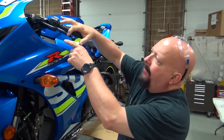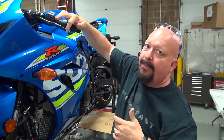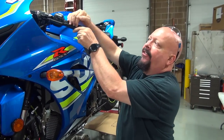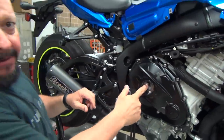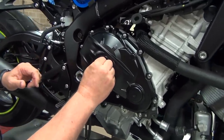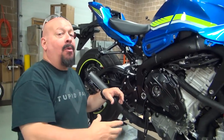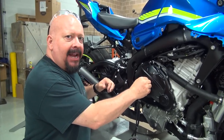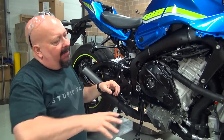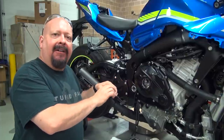When I say secondary — if you're familiar with the cable clutch, you have to have a certain amount of free play up at the lever. If you don't have free play, it's the same as pulling your clutch in a bit and your clutch will slip. Most guys will adjust it — some like the clutch engaging right off the bar, some in the middle, some further out; that's all up to you. But you must have some free play. This adjustment is for free play at the clutch. If adjusted incorrectly or if your clutch shrinks from wear, you won't have any free play and it can cause your clutch to slip.